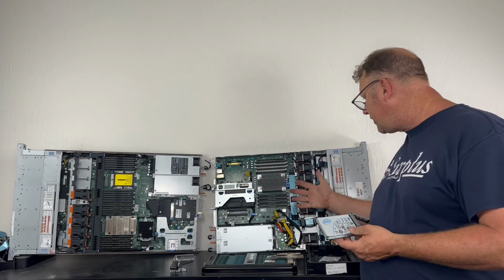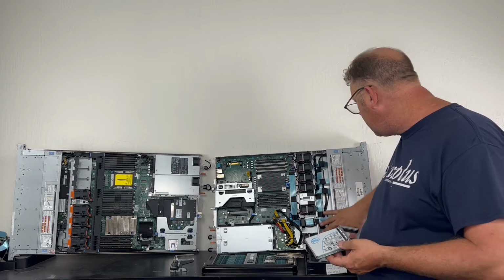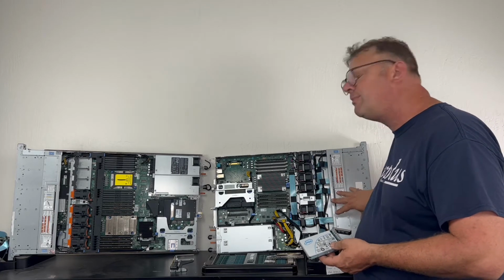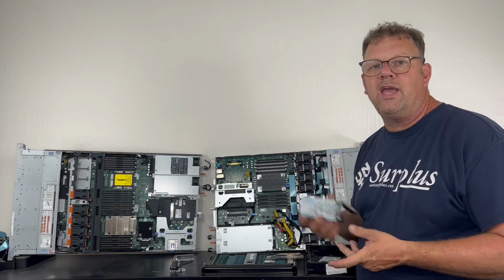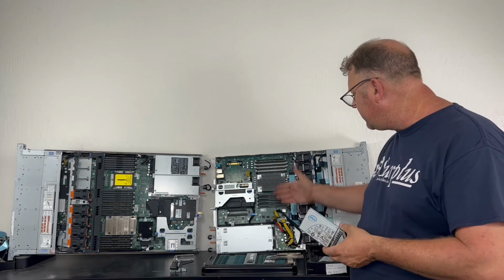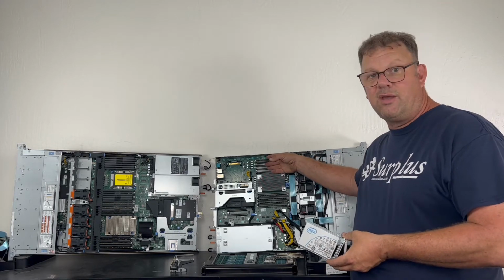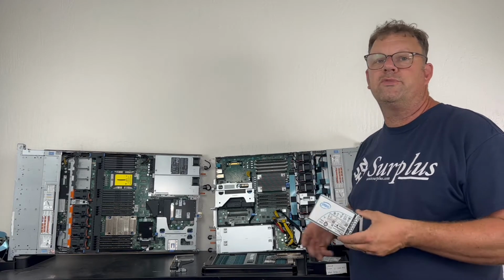But it's a very different design where you can see that everything has a PCIe connector, and all these lanes are coming straight out to the backplane here so that you can do NVMe or PCIe attached storage. So you're taking the CPU core to the CPU core cache to the DRAM memory to the drives is almost one latency.